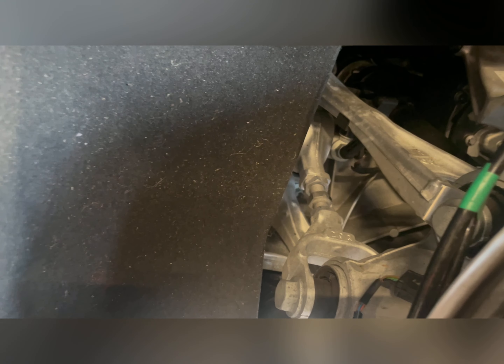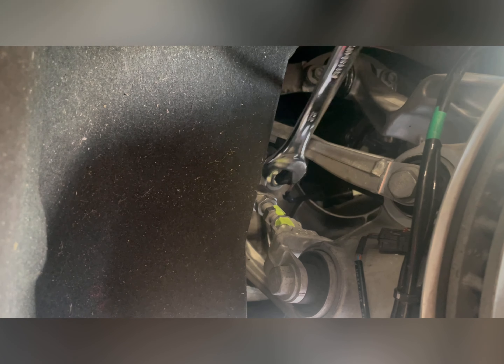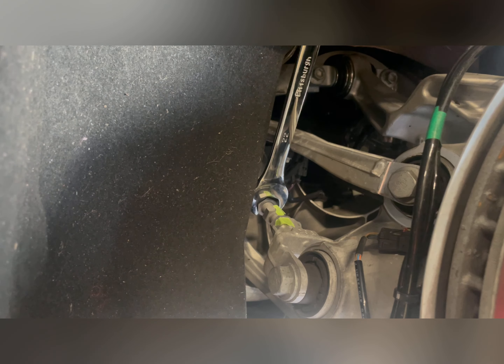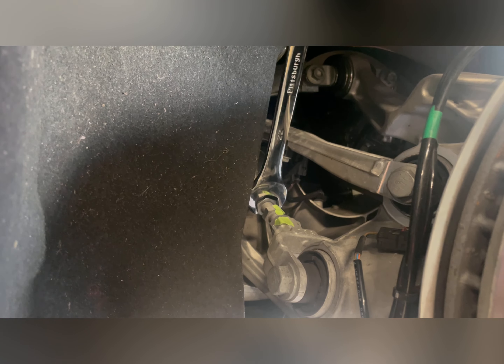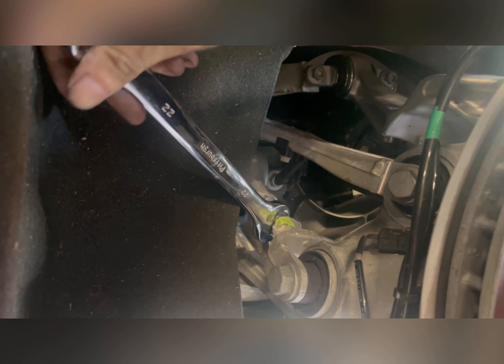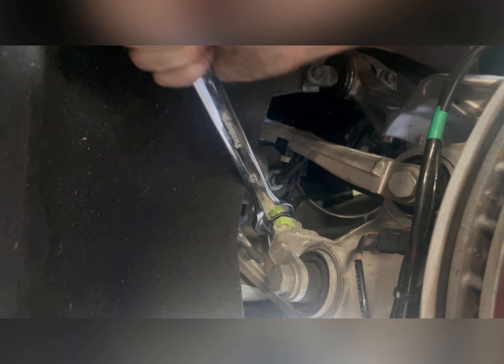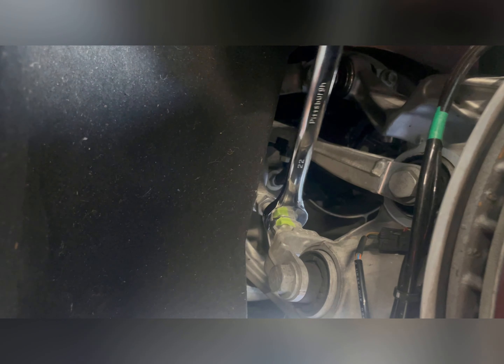Now I'm making the adjustments so that your alignment doesn't change — I'll show you that next. You've got them marked here. Tape to loosen these jam nuts so you can turn the middle piece. Three-quarter turn clockwise — so that would be to the right. Loosen this first. There's not a lot of room to work in here, to be honest. That one's a lot easier to loosen than the other one.